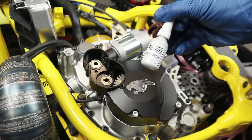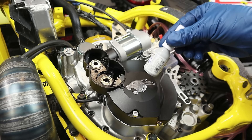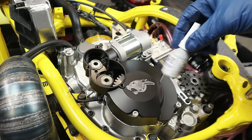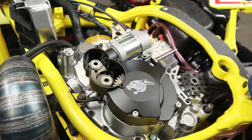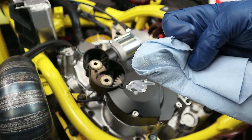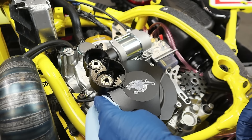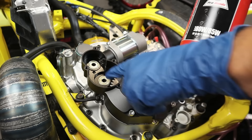Taking these slowly until I feel the cover start to land on that gasket, then we'll set some torque. Keeping an eye on the 1211 — I want to make sure it squishes out. The depth of the gear and everything seems all right. That bolt up top seems like it's doing what it's supposed to do this time. Panthera does want you to use a light-duty or blue thread locker on all four of these bolts. We're not doing that right now because we're going to swap them out for black hardware, but make sure you know to do that. Next step: get a clean rag and wipe off that excess 1211.